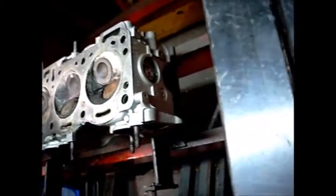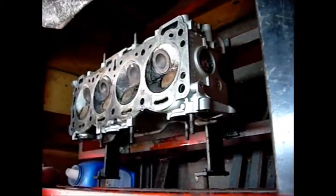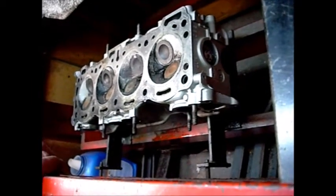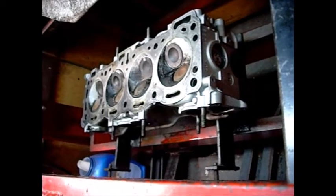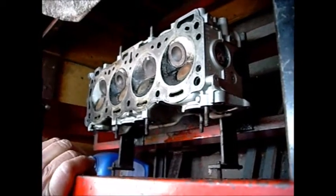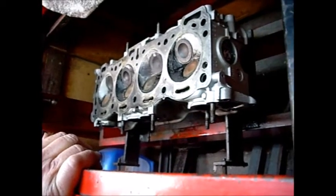Based on the color going on here, this thing just needs a valve job. This one — the water slowed out of it and you can see it's burnt over here. There's something going on on the side of this one. I did have a carburetor problem — a drip that would cause it to load up at stop signs. I ran it for almost a year like that before I finally got that drip cleared up.